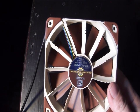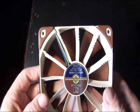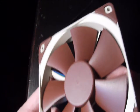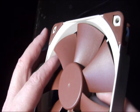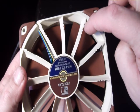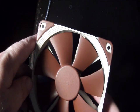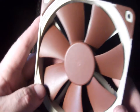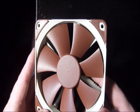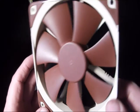This also has a HEPTA perf impeller — a new custom design focused flow impeller blade. If you look closely, there are small pin holes on the inside of the rim, and on the back side it's beveled and then flat on the inside where the pin holes are. That is their inner surface microstructure, which helps reduce blade passing noise and improves airflow and pressure efficiency by breaking up airflow from the suction to the push side of the fan.